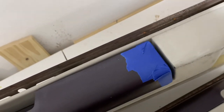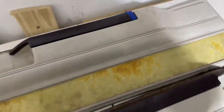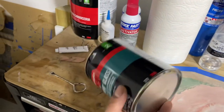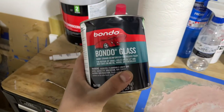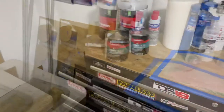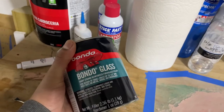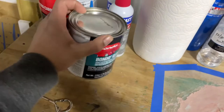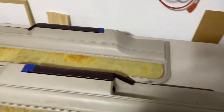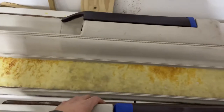Both of these doors are actually like that, so we're going to go ahead and get those filled in with some Bondo Glass. I'm not sponsored by Bondo, but they sure can sponsor me if they want to. What I'm talking about is Bondo Glass — it's actually a fiberglass filling resin. Bondo, you want to sponsor me? Come on! But we use the Bondo Glass, which is fiberglass with resin mixed in, and it'll help make this strong.